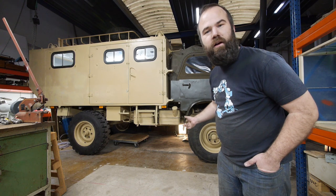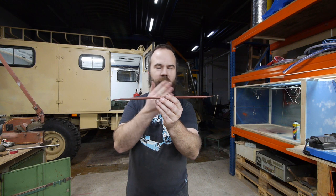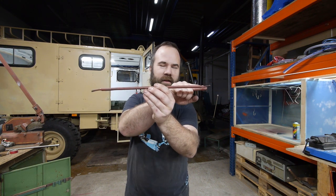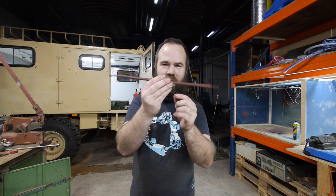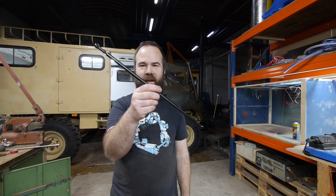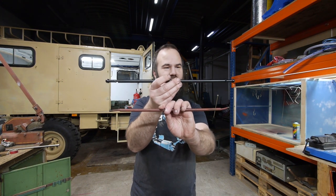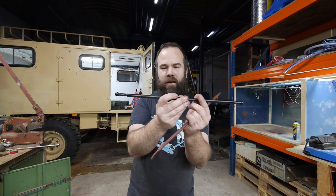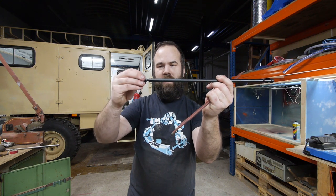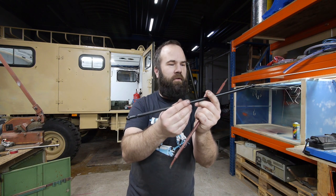Next time I do a test drive, I still need to adjust the gas pedal. This is the old linkage between the gas pedal and the engine — as you can see it's bent here and here and it's rather flimsy. I found some better material and made a much stronger version of the linkage. I can also adjust the heads here and screw in or out for extra micro-adjustment. So this is also fixed — thanks for watching.